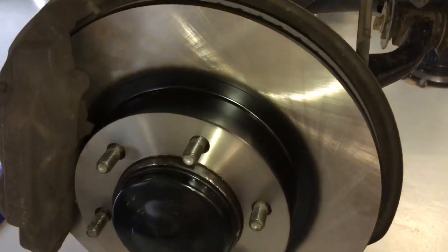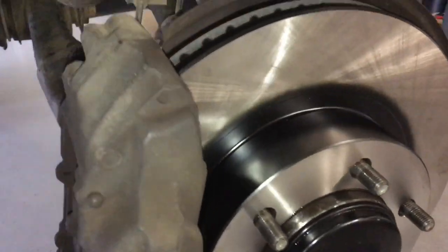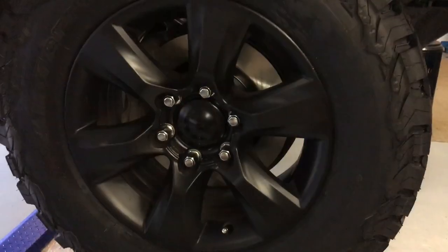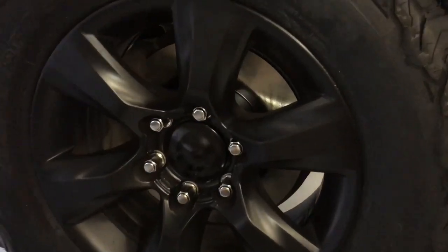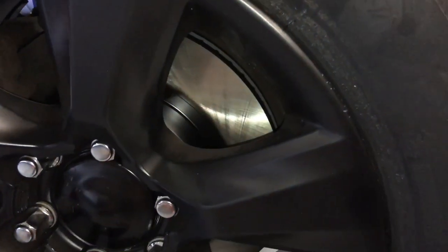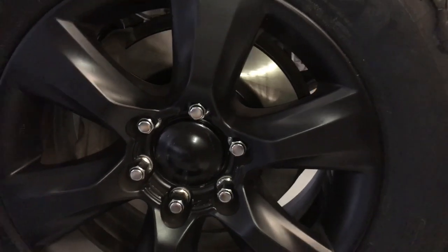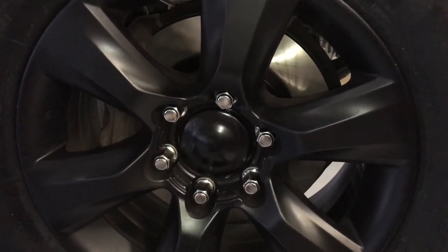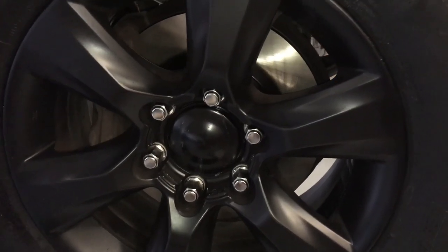Guys, let's get over the other side — or that's the video if you liked it, smash the like button. Look how good these look though — I'm hanging to get the wheels on and see what it looks like. There are many causes of disc thickness variation, which is the whole reason we're here changing these rotors. We talked about cleaning the hub — that's one important thing. You also need to make sure the caliper is working right, so all the pistons, slides, and everything.